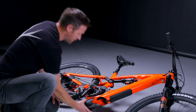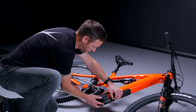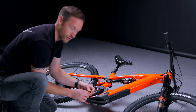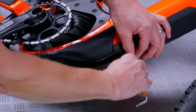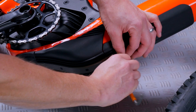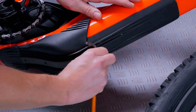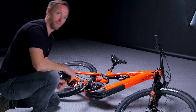Grab your battery cover and slide that over. Move the mud flap slightly out of the way and give it a tap. Grab your 5mm allen key and bolt and reinstall the bolt — again, it doesn't need to be super tight, maximum 10Nm — and replace the mud flap.